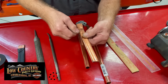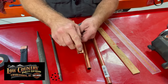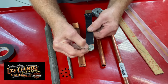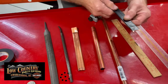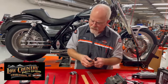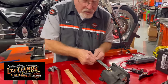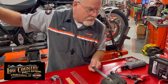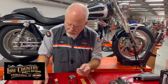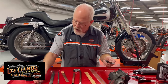I bent the last inch over to give more girth for the booster cables to hold onto. You'll notice there's a round part — when I finished the tool I made a round section about the size of a quarter. Why? Because if this piece is flat and I'm touching the starter stud while reaching to hit the starter button, it could slide off, and I don't need the positive touching anything underneath my oil tank. So I made a groove that will stay in place, so I can concentrate on hitting the starter button. I used a rounded file — whatever it takes to get that shape — so it will stay and you don't have to concentrate on holding it.